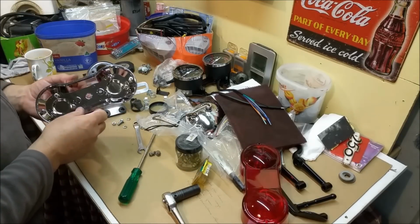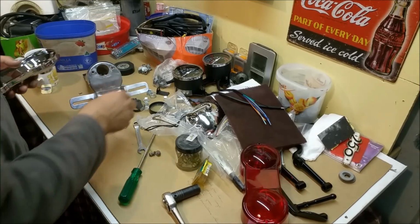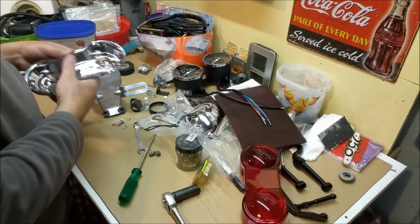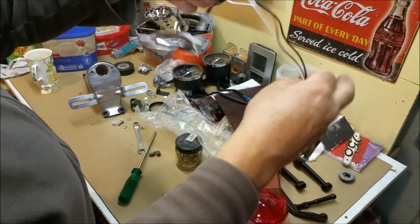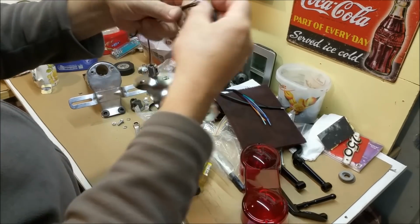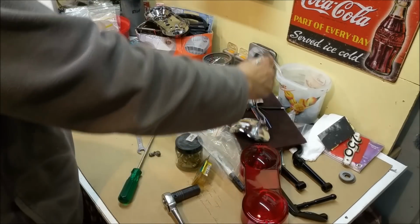This is our aftermarket taillight. Chintzy plastic. You know it's cheap because it's got everything held in with self-tappers instead of machine screws, which you get with plastic. Can't do much about that. Reflectors are here. The reflectors are actually wired individually. They're just sort of terminated in these bullet things. So we can take those off and just connect the original fitting.